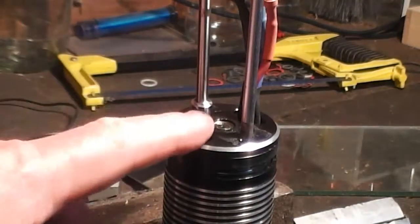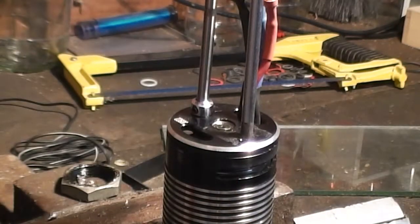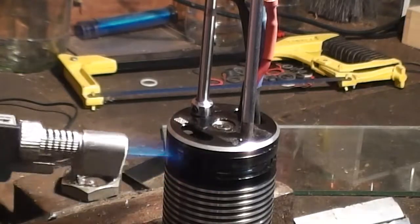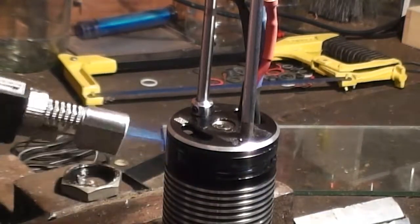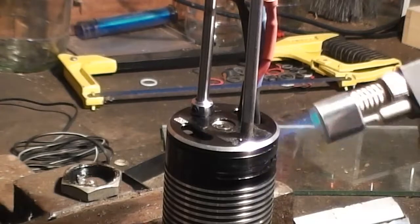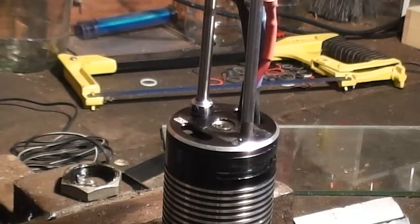You'll find that it's really, really tight to get this off. I have cracked it off now. I've got my blowtorch and what I did is I put an even heat — because threadlock takes about 220 degrees to go off — so I went around just like that. Try not to get it into the windings, but just get it on the outside. Just give it a bit of heat all the way around, and what that does is it releases the threadlock.